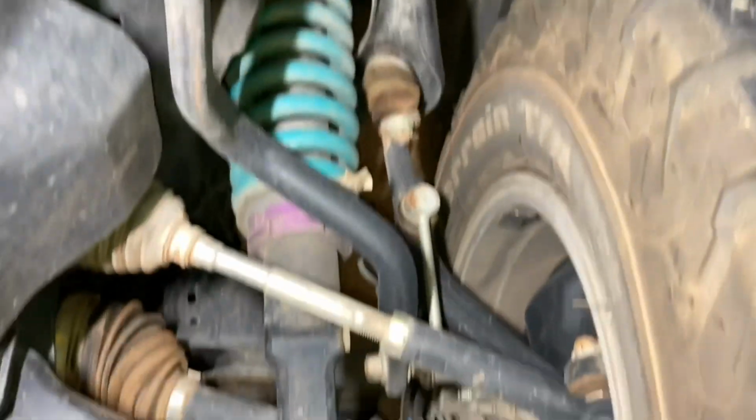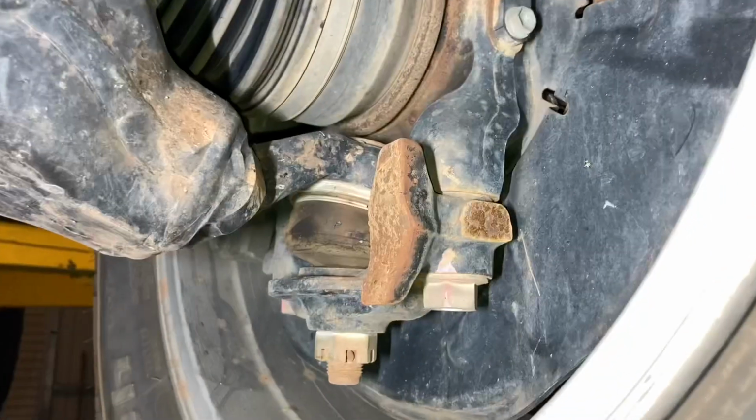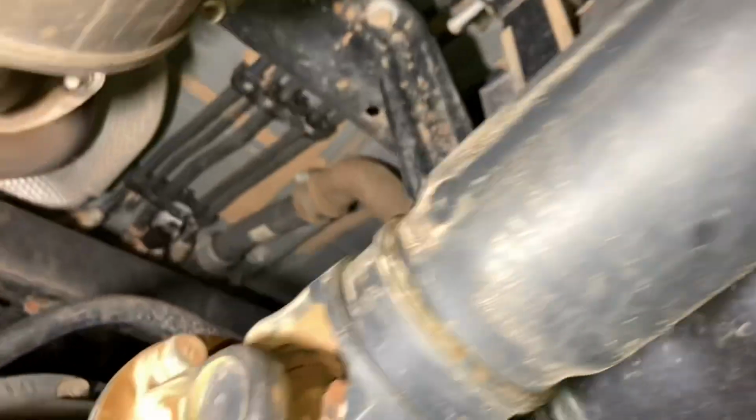Checking the suspension looks good. All leaks and deterioration at all your drive shafts, shockers, axles, link pins, ball joints. Everything looks normal here. There's no oil leaks other than the oil leak we've created. All your bushes and everything look good. The vehicle's way too new to need to worry about any of that sort of stuff. So you're basically looking for, if any, and as I say, it has not been cleaned underneath here properly yet. It's just had a quick cleanup, and we're just doing a quick inspection.